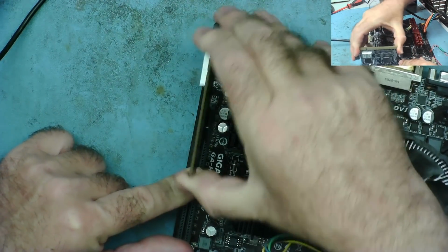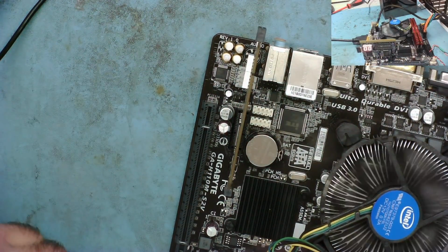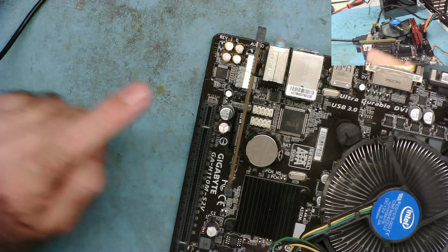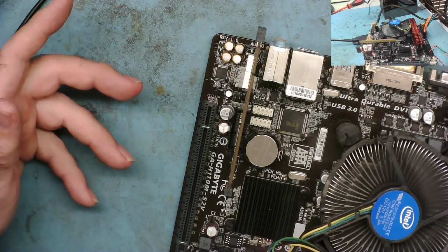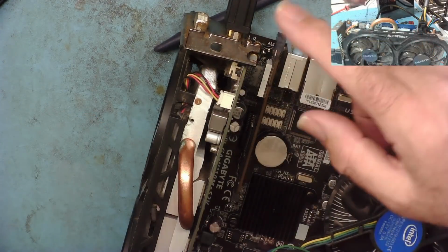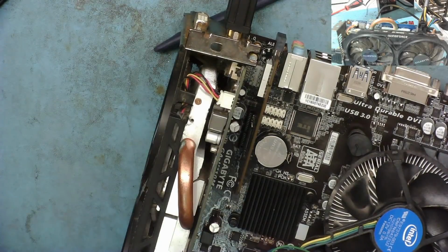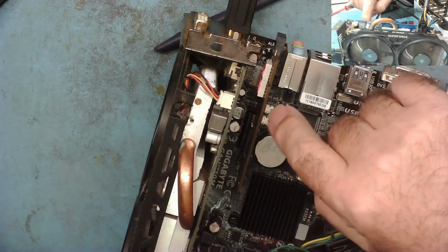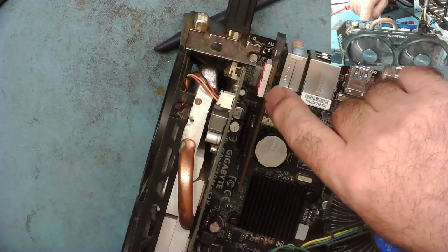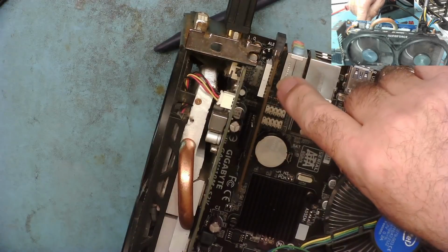What I'm going to try next with this is I'm going to try a GPU in here just to see if it actually works, and if that doesn't work, I'm also going to try a single mining adapter from here going to a GPU to see if that works, and maybe that will tell us a little bit more about this one. I have a working GTX 750 Ti here, so we can just try this one. I have the analyzer card and you can't see it, it's behind here, but it's still going to 97. I can see it. So let it go again. So that still goes to 97, then resets. Well, once more, let's see.